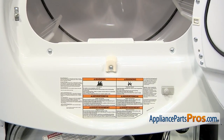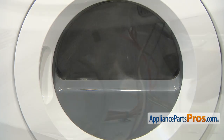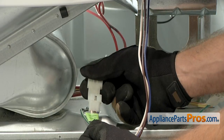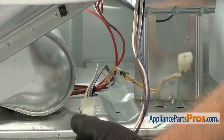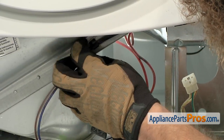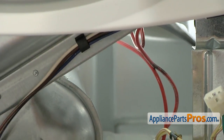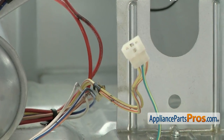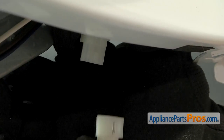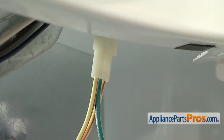With those two screws installed, close the dryer door and reconnect the wire harnesses underneath. First reconnect the door switch connectors — plug them in for a good connection, then route the wire through the clip and squeeze it to lock it in place. Then reconnect the wire harness for the moisture sensor — reach up, grab the harness, line them up and lock them together. Once the moisture sensor wiring harness is reconnected, put the access panel back on and use the nut driver to put the quarter inch screws in.